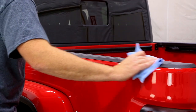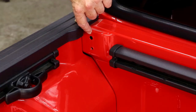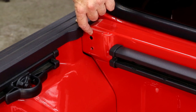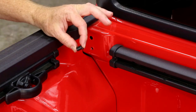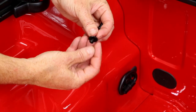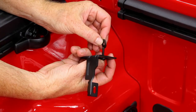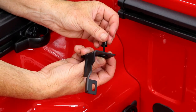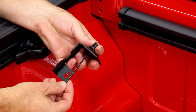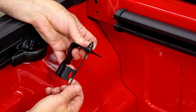It's important to get your bed rails clean before installing a new soft cover. The cab brackets bolt up to the inside edge of the bulkhead wall using these two holes. The lower is threaded, the upper is just drilled straight through and takes a small well nut or expanding rubber nut. Slide a flat washer over the screw, insert the screw through the top hole of the cab bracket, then another flat washer, and then the well nut.